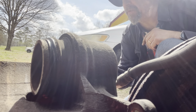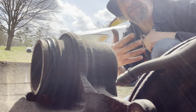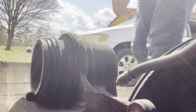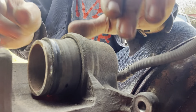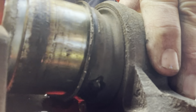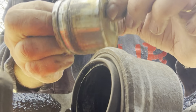Now when you're doing this, pumping these brakes up like this, you've got to be sure you keep brake fluid in the reservoir. If you pump it a few times and it doesn't pop out, fill your reservoir, make sure it doesn't run out, and try again. If we look at the one from the other side, we can see that it's nearly out of the bore, so we can probably pull it out from here. See how that's bobbling around? That means it's barely in there. There it is — look at how nasty and crud-covered that ugly thing is.